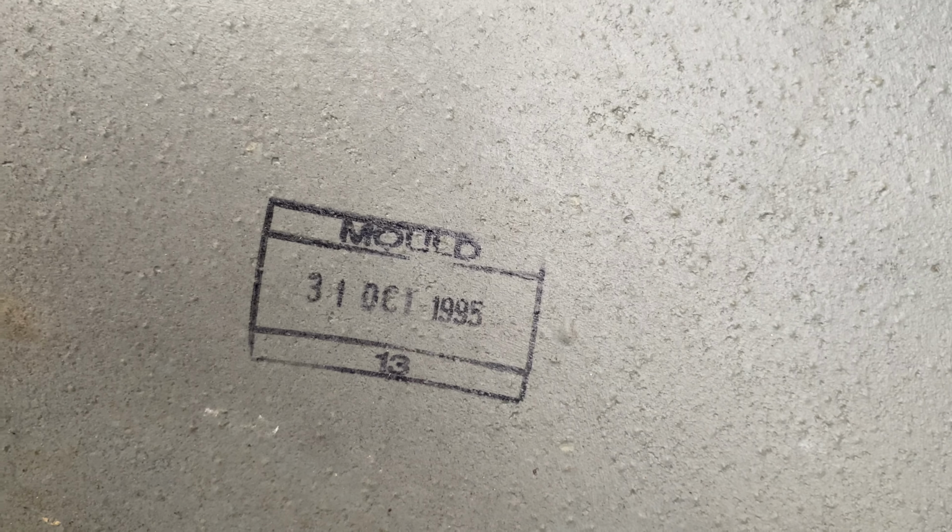What I do need to check is if this underdoor seal is original or not, because my understanding is that water goes into these drain holes and can leave, but if that's in there and against there, then all it can do is flood my carpet, which it does do. And we then have slight bits of corrosion in places like here. Now I've got some thoughts, so we're going to go into the car and have a little discussion about how I'm going to treat these, because there are some options.